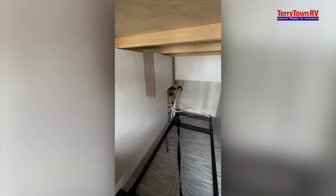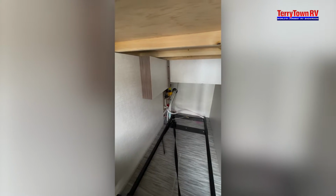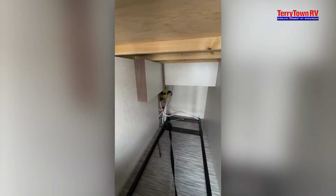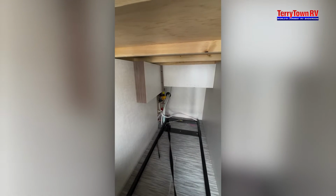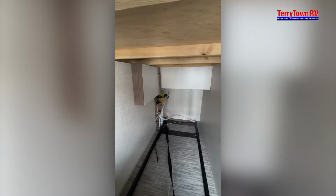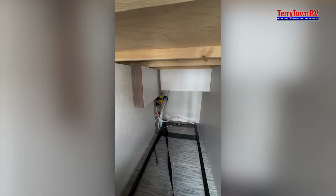You can sort of see it there. You're gonna twist that to face that cutoff end hose, turn the pump on, and that's gonna start pumping from your jug. So once you got that water pumping, you'll come to your outside shower here and just run it until it's completely pink coming out of there. Make sure that you've drained your fresh tanks out, and then you're all set.